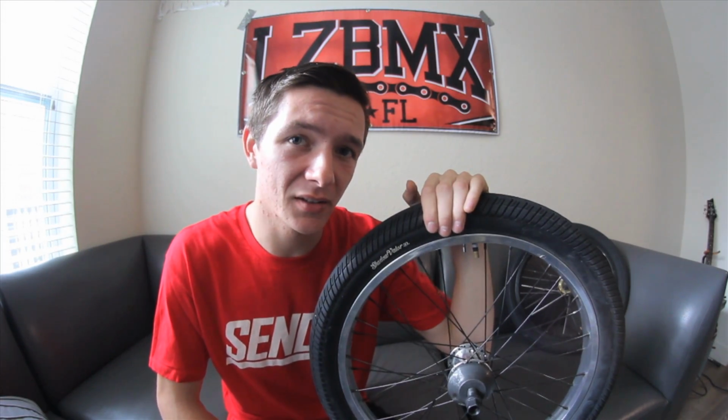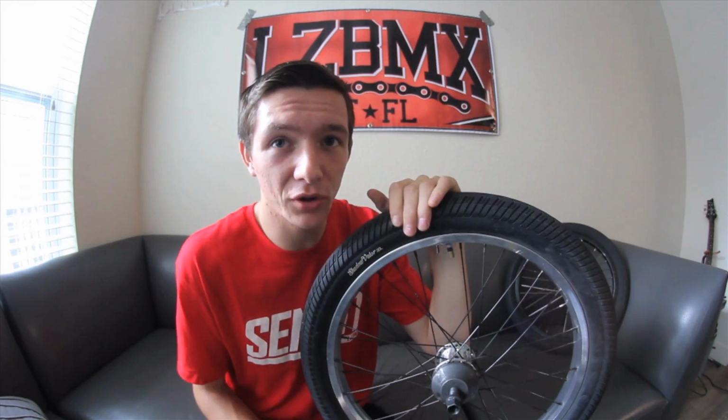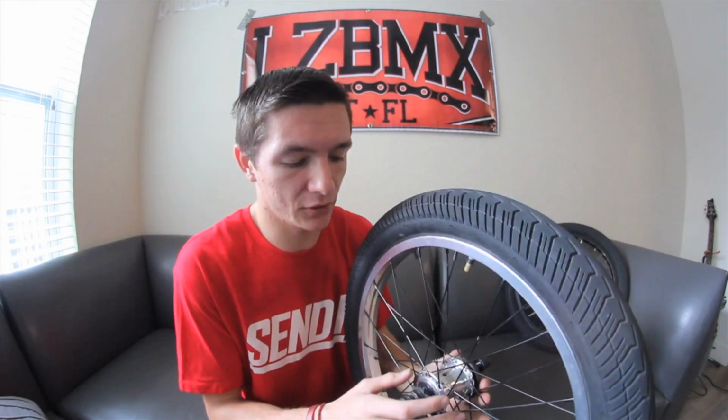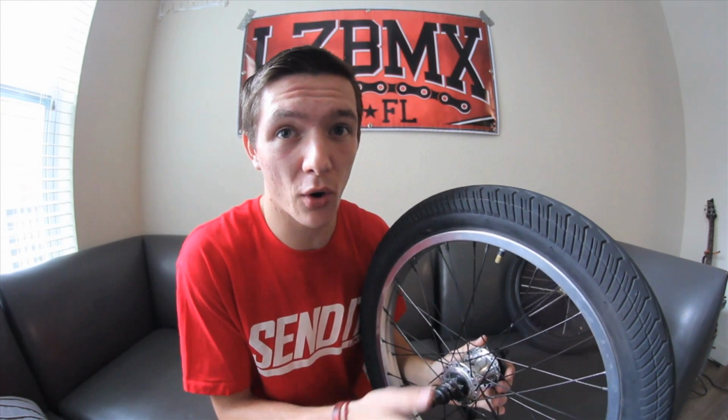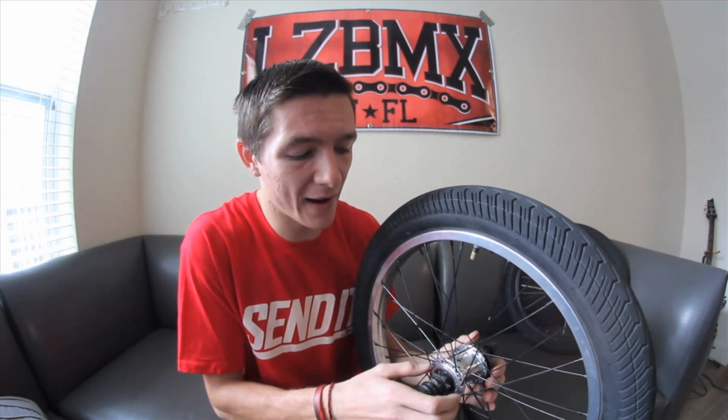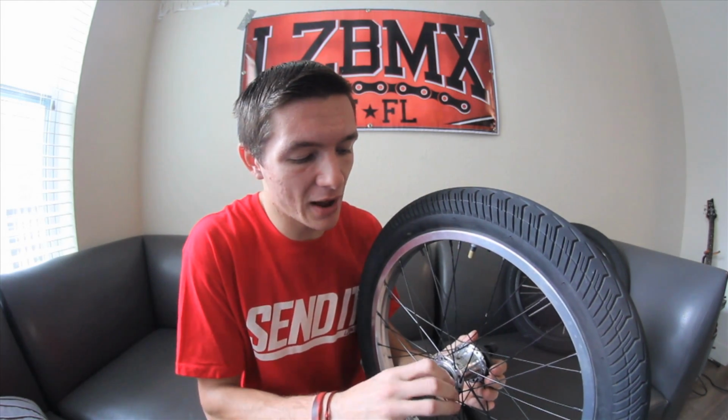You guys have probably been told that Freecoasters break a lot or that they're high maintenance. A lot of that's not true, and the only people that you hear it from are the people that have issues. So it sounds like there's more issues than there actually are. The truth of the matter is that Freecoasters do require more maintenance just because of the nature of the design. The bearings will kind of wear out. You may have issues depending on how you ride. If you take care of your hub, you'll be good. It's just something to keep in mind.